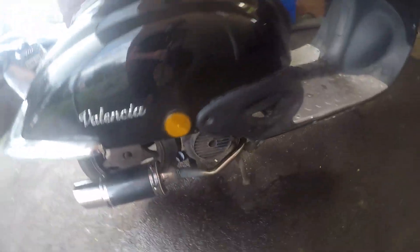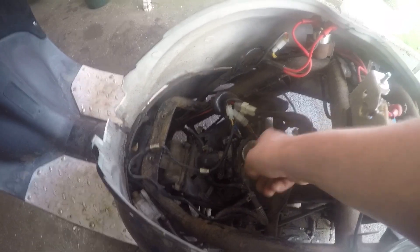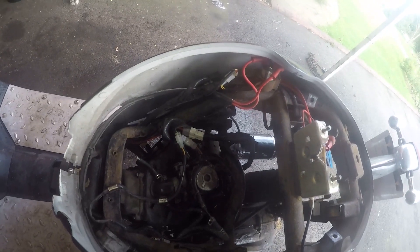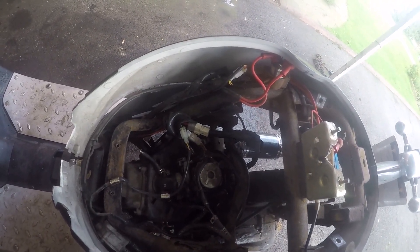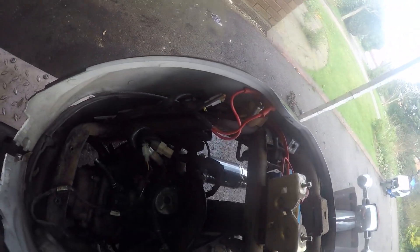Hopefully we're pretty much there - the exhaust is on and welded. Had to do a bit of a bodge with a bolt to get it to stay in place because obviously this isn't meant for this bike, but it's on and it ain't going nowhere. Battery's on, carburettor's on, and I've primed it. It's got a vacuum pump so you have to keep sucking it to make sure there's fuel in the carb. The battery's been charged so yeah, hopefully now...